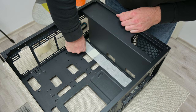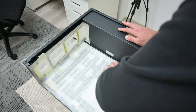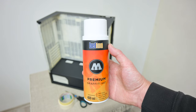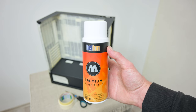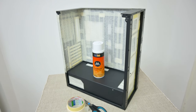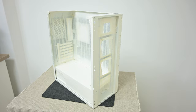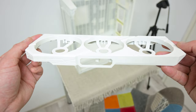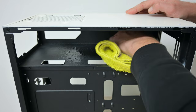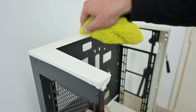After I finish with cleaning, I move to taping. The PC case is going to be in two different colors, so I need to separate the painting. First, I will use a white spray — this is not a pure snow white, it has a very tiny shade of yellow. With this spray, I paint some parts of the PC case and the front GPU plastic. After the spray paint gets dry, I have to re-clean the whole case, because the spray causes dust fallout which will cause problems with the next painting.